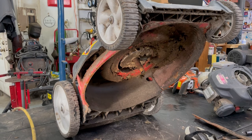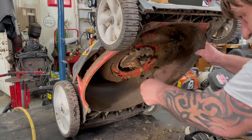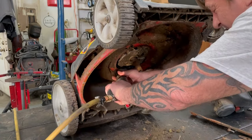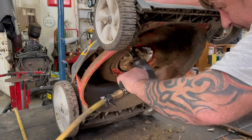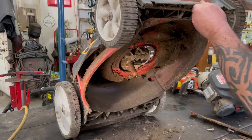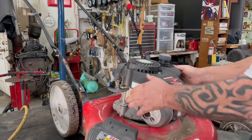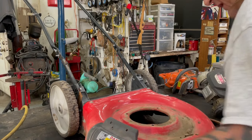Now we can go ahead and take those three bolts out. Pretty much all these push mower motors, the bolt patterns are all the same. These here are half-inch self-tapping bolts. On the last one, kind of hold your motor so it doesn't go rolling. And there we go. I'm going to save a few parts off that motor, like the carburetor and the tank, because we use them on something else.